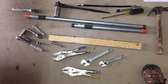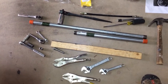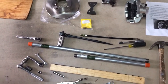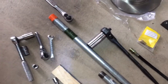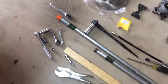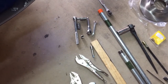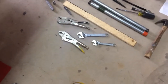I used a piece of wood between a couple bolts to get it loose, otherwise I went to two cheater bars — a long one against the floor and the other on a wrench. You're going to need some stout wrenches. By the way, the fork is 24 millimeter and you need that as a long socket; the others can be short. A universal knuckle for your socket wrenches is a must, and you're better off using 3/8 drive — I had a struggle using half-inch with crescent wrenches.